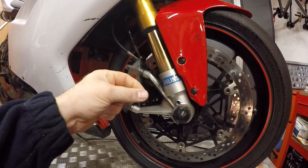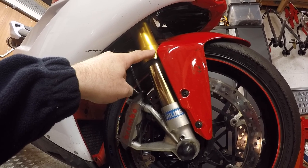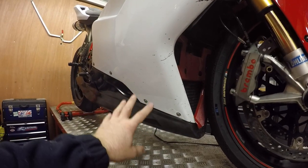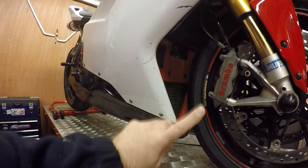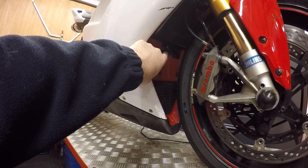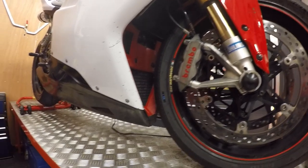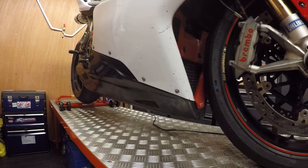I've noticed today that it looks like I've got a little bit of passing oil on the fork seal, so I'm going to be doing the fork seals with fresh oil. I've got a whole new set of pads arriving for the front and rear calipers. I won't film it but I'll be doing an oil change and filter change, and I'll get a new set of spark plugs fitted. The bike will also have a really good clean before going up for sale.